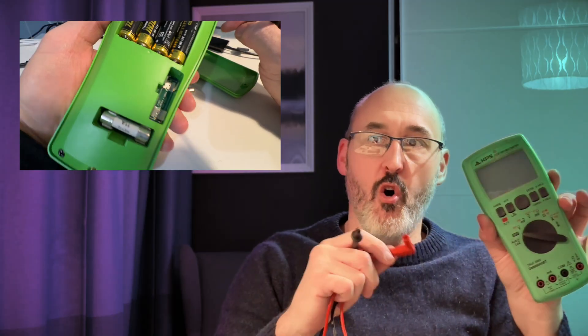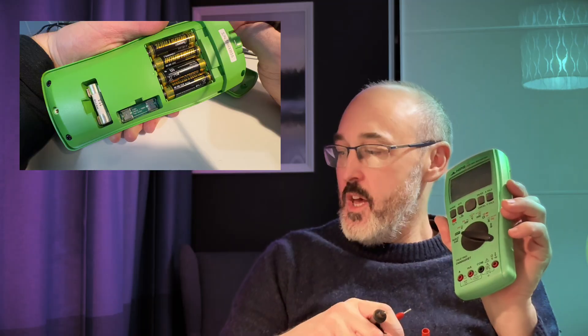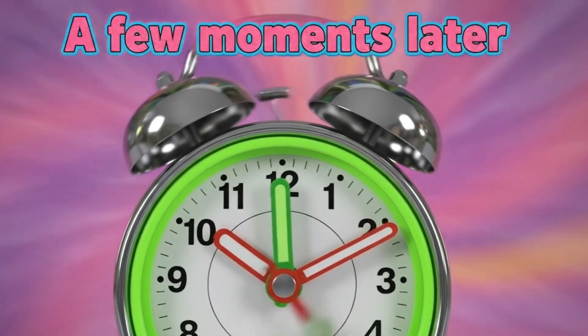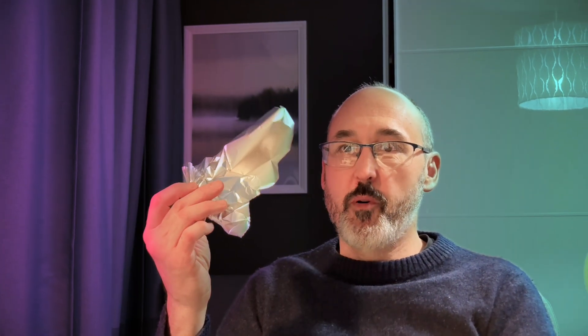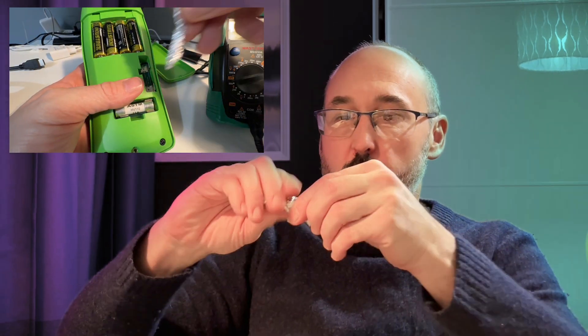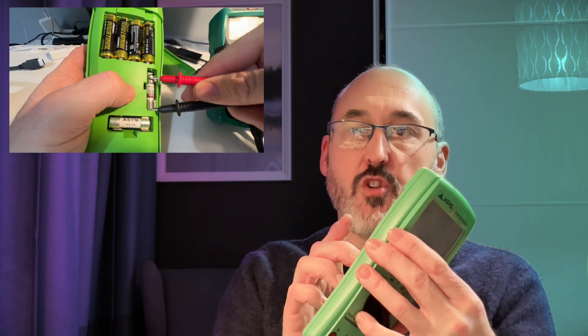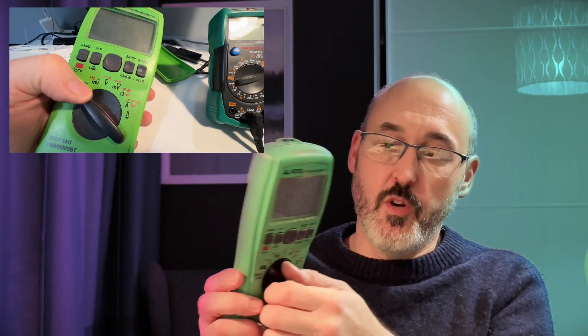So what we're going to do, just quickly, is cover a couple of ways to test the fuses. First, let's assume you don't have a spare multimeter. Dead easy: a Kit Kat wrapper or a piece of tin foil. I went to the kitchen and got a piece of proper baking tin foil. Just tear a piece off and shape it around the fuse — the goal is just to bypass the blown fuse and touch both caps. When we switch it on, we'll find it's magically working. It said 'fuse' because it was a bit loose, but you get the idea — it's working.